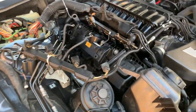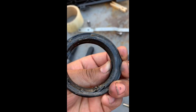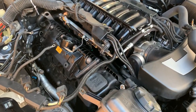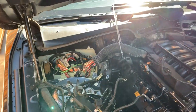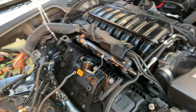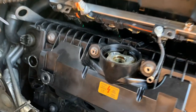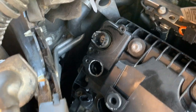To start the removal, I removed the breather, then the coil packs and the ground strap, took the DME cover off, removed the coolant reservoir and the power steering reservoir. Then I was able to remove the Valvetronic motor — there are four bolts that hold it and another one that holds the metal mounting plate that slides in with the gasket.